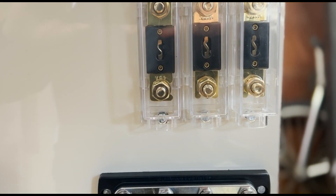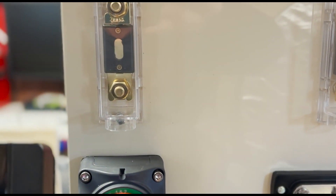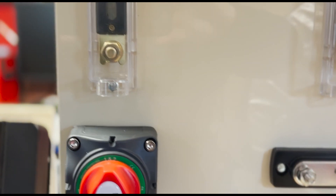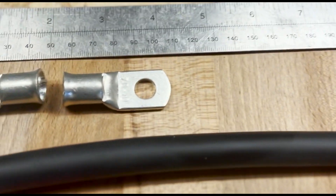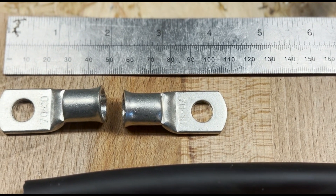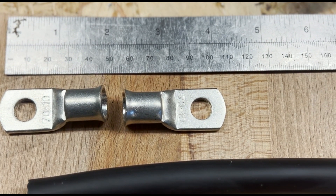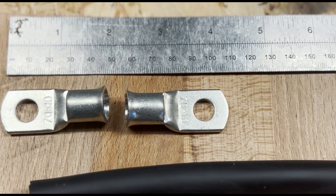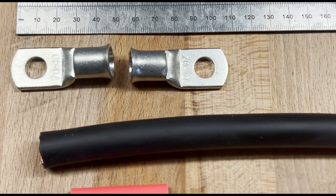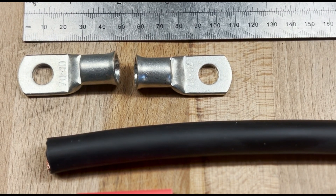You could say there's an awful lot of space between the fuse and the busbar, or the fuse and the isolating switch. But the challenge is that we're going to have to make some cables up, and these lugs for the larger cable will need about four inches between each of the two holes as a minimum. After that, trying to bend this cable to make it look neat is also going to take space, which is the reason why I've made all the components slightly spread out.